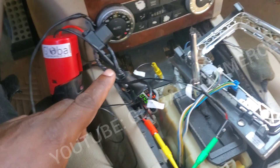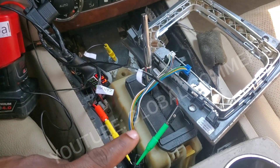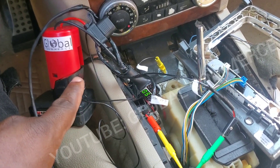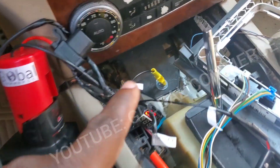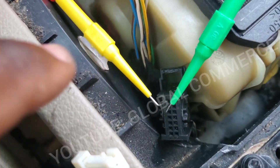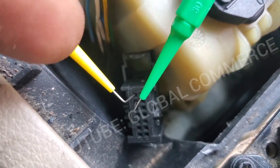We're going to go ahead and do some tests at the connector for the ESM — electronic shifter module. We're going to use the ultimate CAN bus tester right now. There's going to be a link in the description with more details about this product. I'm connected to ground right there, I grabbed ground and CAN high — if you saw the diagram, that's going to be pin 7. You can see the yellow lead is in pin 7.